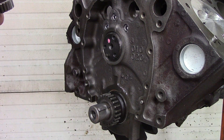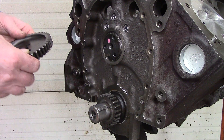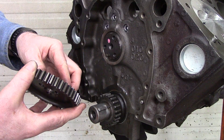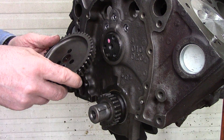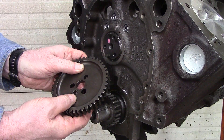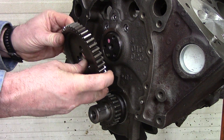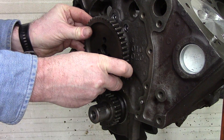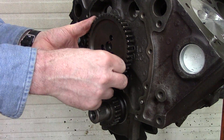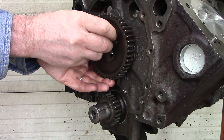Now it's time for installation of the timing gears. I'm going to install the existing one I had on it — it only has about 5,000 miles on it and it is a Pete Jackson gear drive. It comes with the brass wear spacer that goes on the back side, so you've got to make sure that goes into the correct spot. It also has the adjustable timing bushing. I'm putting on the straight one so it's dead on to the original timing. You can use a timing indicator and verify where you're at, and degree it with a degree wheel if you want, but I'm not in any racing situation so I'm not too concerned about that.